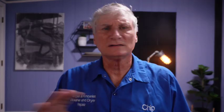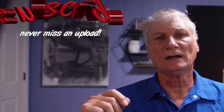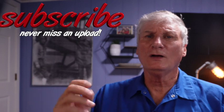Number one: the door switch. If your door switch is broken, the dryer is not going to start no matter how hard you push that start button. One of the first indications that your door switch is failing is if you open the dryer's door and the drum keeps turning — the door switch is broken and stuck in the closed position. If you push that little flapper button and you don't hear an audible click and there's no spring return when you let go, it's time to replace it. Also, if that little flapper is missing, it's broken off and needs replacing too.